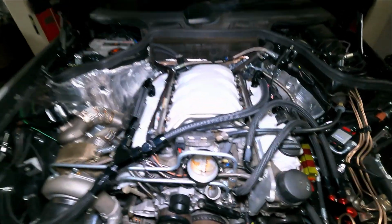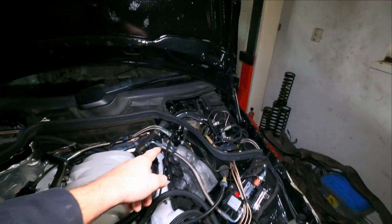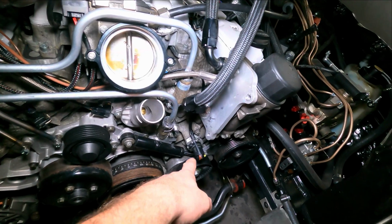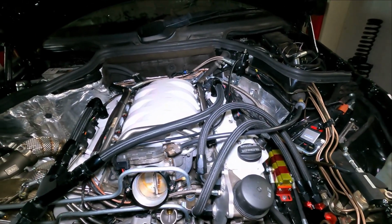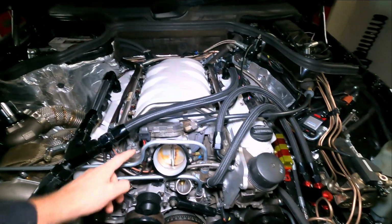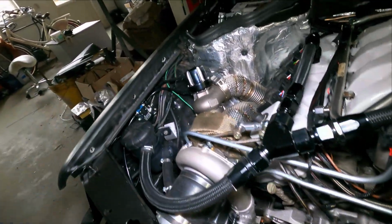So at first in the engine bay, everything is wired in. Throttle body, last time I needed to do this complete loom, I thought. Also got the injectors and everything wired up. Ignition, fuel pressure regulator, has a temperature and pressure on the fuel. Oil pressure sensor and temperature is a double sensor from Bosch. Crank sensor is done, camshaft sensor is in here, is all done. So I can do sequential ignition and injection. You need both sensors. Electronic throttle body, not tested yet. Have a look, all the vacuum hoses are connected, also boost controller, everything is in, everything is wired in.